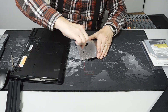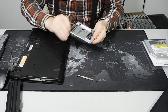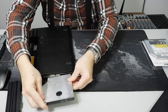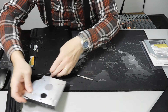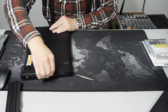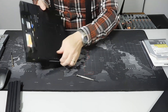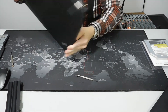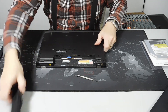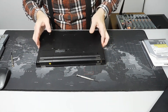Double check that the screws are tight enough. After you've cut that little piece out, take the caddy and — because the machine is upside down — turn it upside down and put it inside the bay. Get it aligned, push it in, and it'll snap to lock so the caddy won't come out. And there you go — now you've got two hard drives or SSDs inside your machine, depending on what you want. Put the battery cover back on.